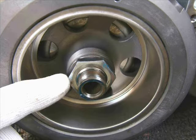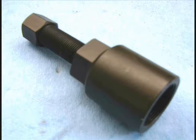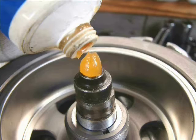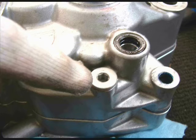The stator magneto has a huge nut, size 27 millimeters. We'll take that off. There's a special puller for getting off the flywheel. I like to use a little roller ball bushing that sits on the end of the crank to protect it from the pressure of the puller tool. I put a little silicone grease on there as well, then two big wrenches to take off the flywheel.